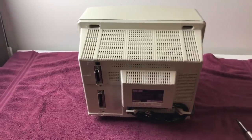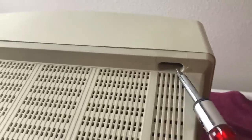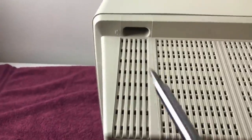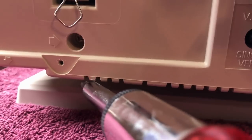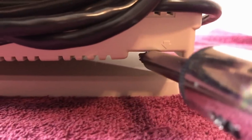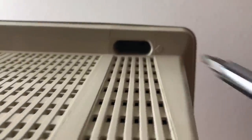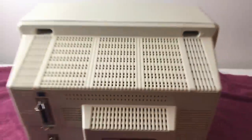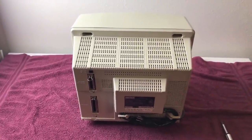What I need to do first is take the back off — there are six screws. There's a screw here, a screw here, a screw here, here, one way under here, and another one way under here. You can see little arrows pointing, telling you where the screws are under there, which is really nice. So I'm going to lay this monitor on its screen and take the back off.